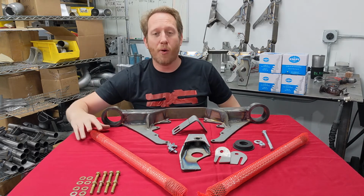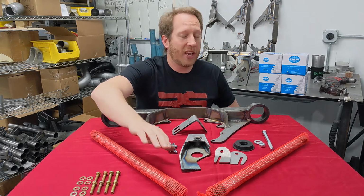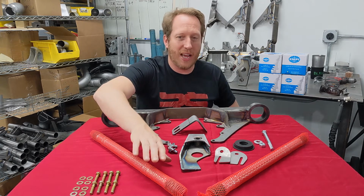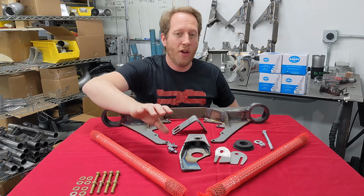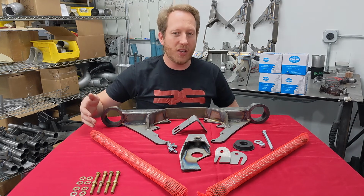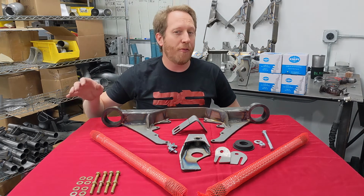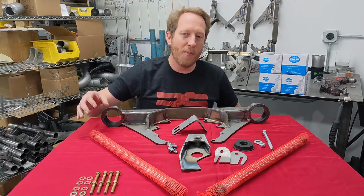So with our FC88 standard kit, we're making the conversion between Ford and Mazda in the half shafts. The inboard end is a Ford Explorer CV. The outboard end is a Mazda T2. Can't run NA cars, none of the naturally aspirated stuff. All those CVs are smaller, not gonna work out for you. Both ends do need to be OEM CVs. If you go down to the parts store and buy something for an Explorer, for instance, it won't be right. It needs to be from an Explorer.